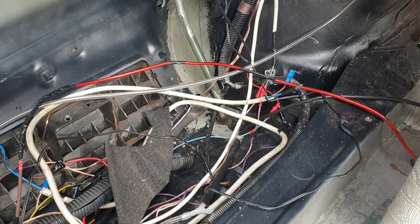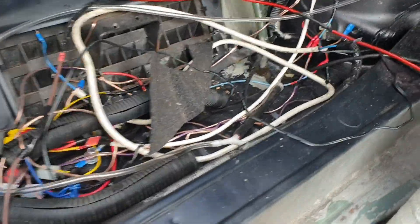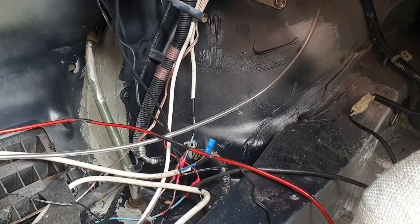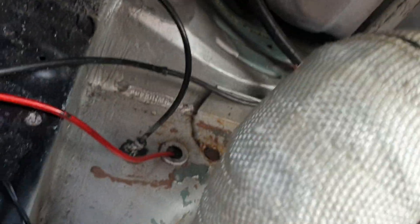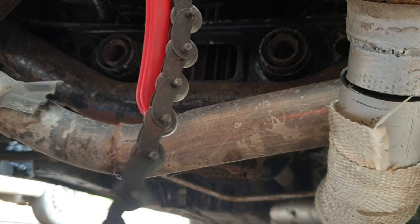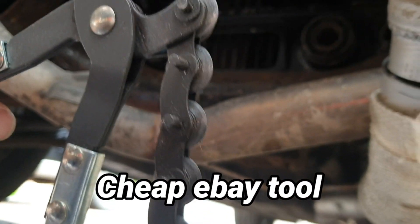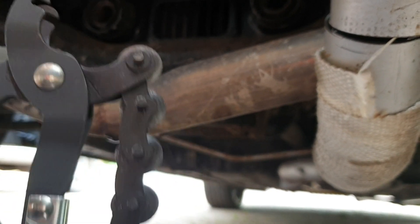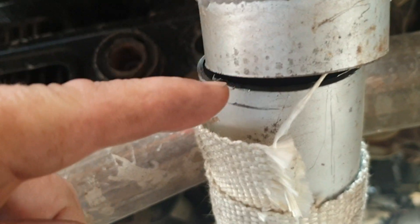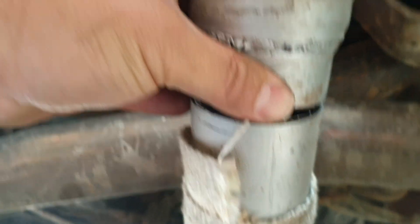I've also been going through the wiring because now I don't need all that big fuse box I had before. I just need one relay, a wideband controller, and the two temperature and oil pressure sensors. The main feed here will just go via the relay to the motor somewhere here. And to get that nice clean cut through that, I used this tool here — a little chain cutter, it's a bit like how you do copper pipes. It gives you a nice clean-ish cut. So I've just got to re-weld that in that position.